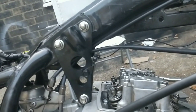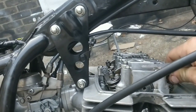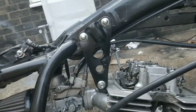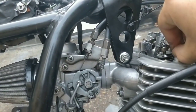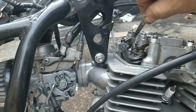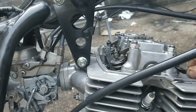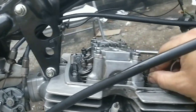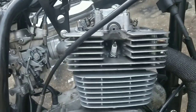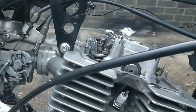I know these aren't right because I set them terribly. That needs a bit of tightening — and the same in here. They both need a bit of tightening. Size nines on here: break them loose, tighten the top bit — with this underneath it should have some drag but not loads, and then you should be spot on. Rotate the engine — there's no drag on that side at all, so that needs to go significantly lower. Tighten them up, check them again, do a full rotation of the engine, and we'll do the other side.